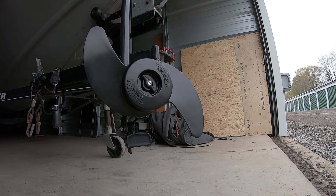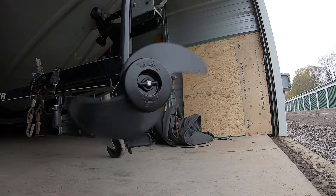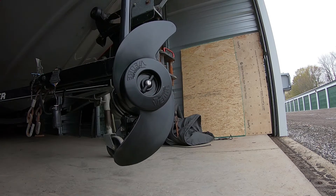Time to give it a test — see how she goes. Oh look at that, is that not sweet! I can't wait to use it. It is functioning — the job is relatively easy; mine was trying to get that pin out. Hopefully you found this video useful. I think with taking all that fishing line out from behind, it's going to make a big difference. Check your trolling motors regularly because they recommend that — something I could be faulted for, going into my third season and never looked behind it.